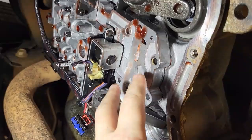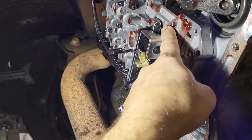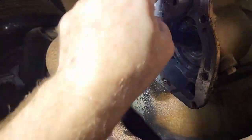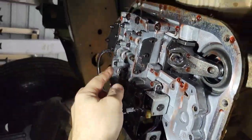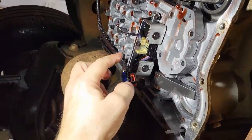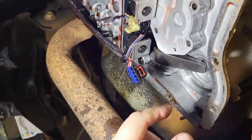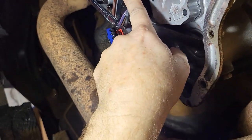I just pulled this base off, disconnected the electrical connector from it. Now we've got right here another torx bit, and I believe there's one on the other side as well — one here and one here. Then we can pull this and work the cable out around to the other side. There's an electrical harness that runs along here. Let me get this off and then we'll go around and disconnect on the other side.